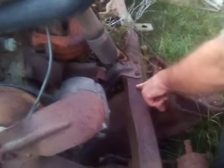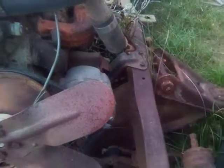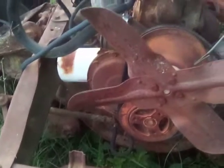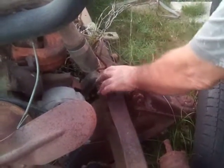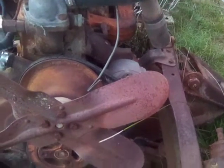This front hole, people will tell you for this, or that. And the only time I've ever seen that front hole used is on the passenger side with a 292 V8. And when it does that, in the one on the passenger side on the 292, it's a different bracket even. And they did that to clear the fuel pump on that 292 engine.